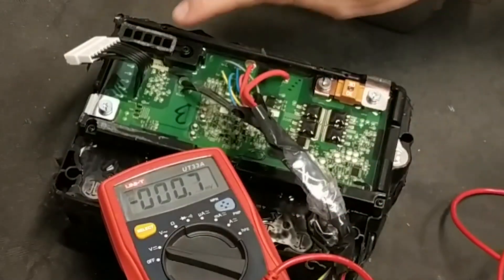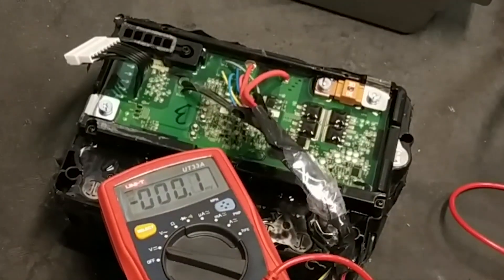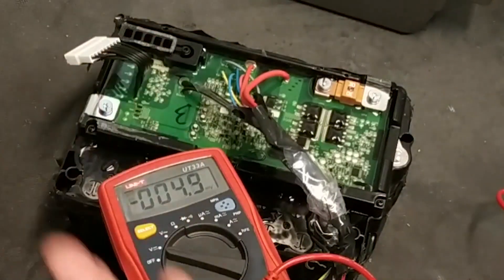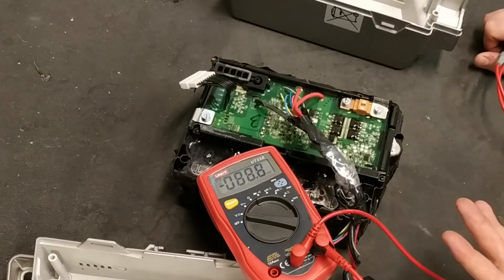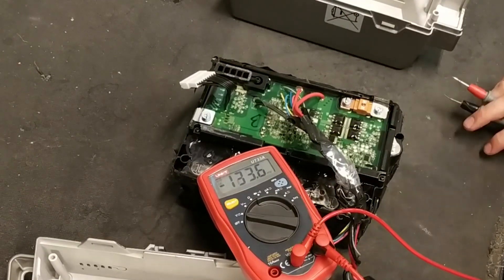What? 6.6 volts. How can this one still work and be giving full voltage — no problem? And these are the connections that go directly from the battery cells. There was no problem running the bike with this battery but it wouldn't charge, which is not that strange because the cells are dead or dying.